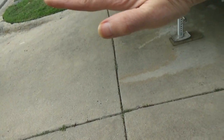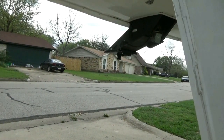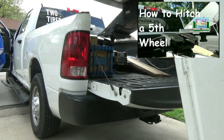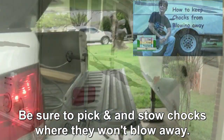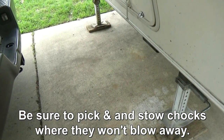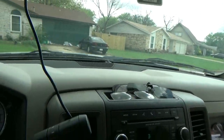One quick tip: because it's on her driveway, this part is at a much steeper angle than the rest of the driveway. When I get home I do not try and level it — I leave it about an inch or so, so that whenever I start to back in I have a good idea about where to start. We do have a video about how to hitch a fifth wheel if you want more complete instructions. We got the electric plugged in, the breakaway on, tailgate up, and raised the landing gear. Last thing before we get going is to put it in tow haul mode, make sure it turned on, then ask God's blessing on our trip and we are out of here.